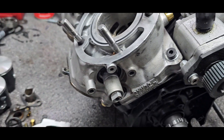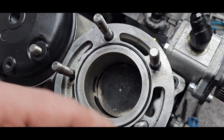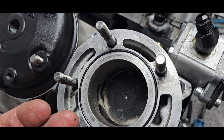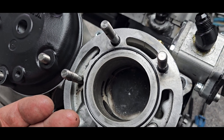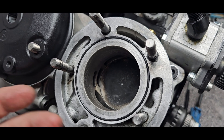The new pistons are here — I have some old dirty ones that I used to measure the squish and also the total duration of opening. I have lifted the cylinders a little bit from earlier. Because now, with the new bearing and the new rod that's longer, I feel it's more safe to let it sing at higher RPMs.